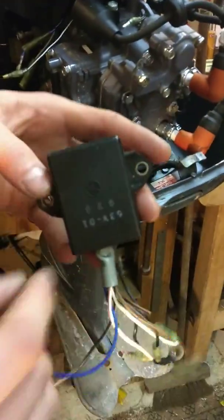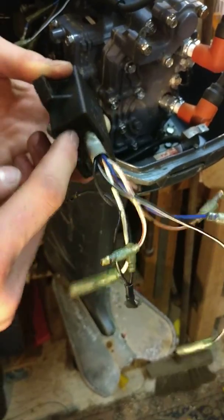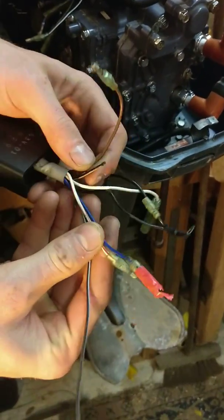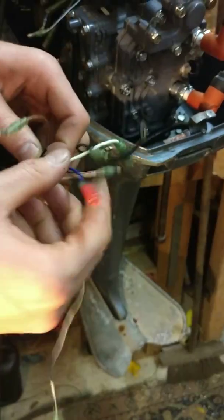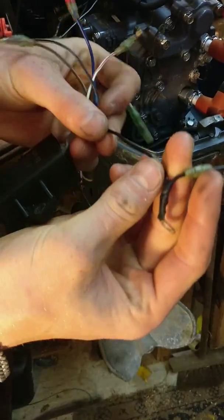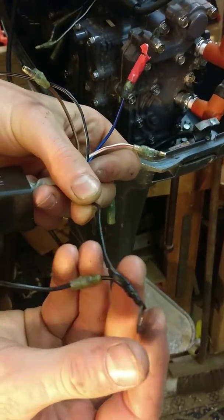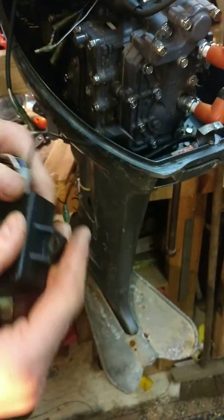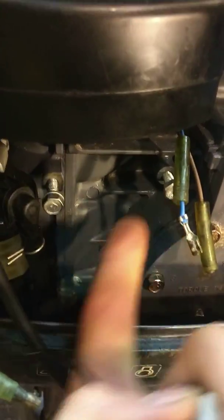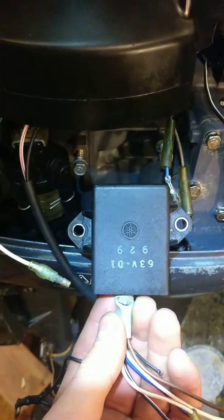This is the CDI unit. It is fitted upside down with the open part at the bottom. On this unit there are a few different wires. This black wire, separate it from the others — it is purely black with a special ring connector, and it is a ground wire. When you attach this unit with the two bolts you'll need a number 10 spanner. I would suggest you plug everything in before you attach it.